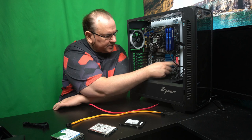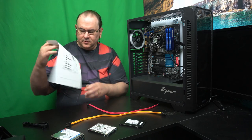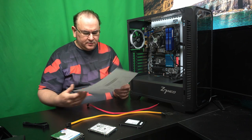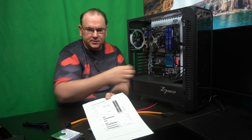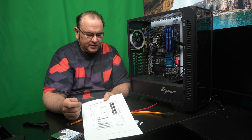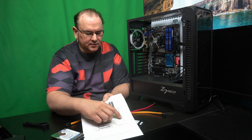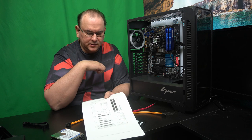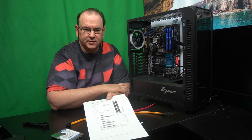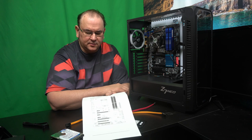On the computer side, basically you have the connectors for the data to come in, and in your motherboard manual you have a diagram of the connectors, and it shows you where the SATA connectors are. It can be in a group, or they can be distributed in several locations. It varies. Now the most important thing to remember is that these connectors are usually grouped, and each grouping of SATA connectors goes to possibly one or more SATA controllers, and each SATA controller has the possibility to support different speeds and different RAID configurations. So not all the connectors are born equal, one can say.